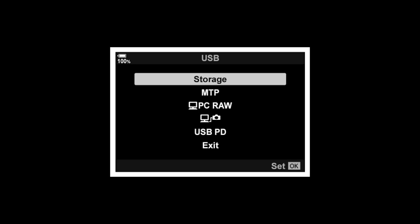The most direct and honest way to say it is that when the USB port is engaged or being used at all, the HDMI output is disabled. That is in fact what's happening, even though the camera has a built-in menu where you can tell it you're using it for storage, a PC connection, or PD power. It doesn't seem to matter, and it's weird because every camera I've used in recent memory that allows USB power input also allows you to use the HDMI port at the same time — because field monitors are a common thing, and I'll demonstrate that in just a minute.